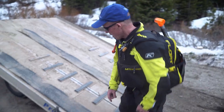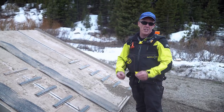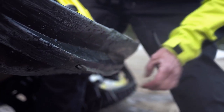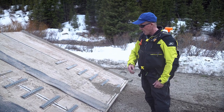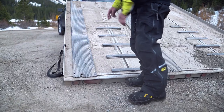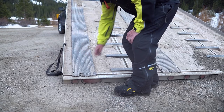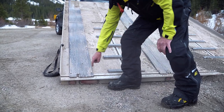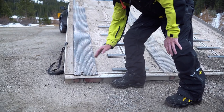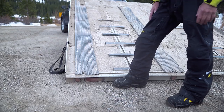One thing that really helps are these trailer slides and the traction aids. Snowmobiles have carbides on the bottom of the ski, and what happens is you'll dig into the deck. With the slides being plastic, it glides right up. My trailer slides are lined up so the carbide — the center of the ski — is in the middle of the slide, and I have mine back a little bit. The carbides can still catch, so you can actually get an edge glide that wraps around and you're less likely to catch a carbide.